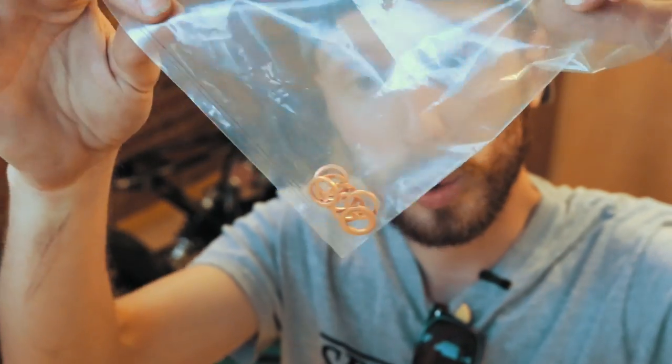What I need to do now is go around fitting all the copper washers, get some fluid, and see if they work. I need to get a pipe from the master cylinder to the reservoir and make sure it's at the top above everything else. I'd rather have brakes before I actually get the bike started. So I'm going to go buy some brake fluid, get some hose for that reservoir, and make a bracket.